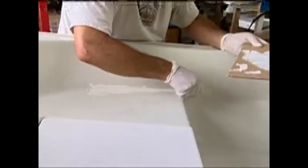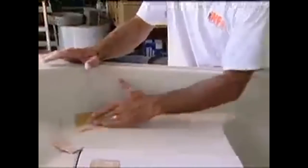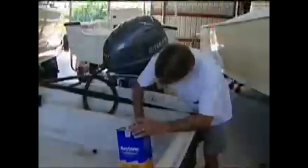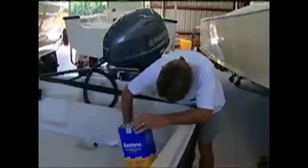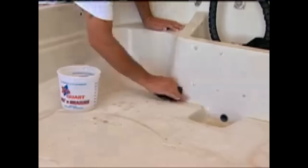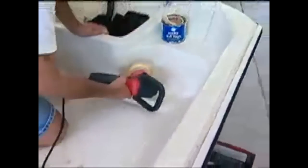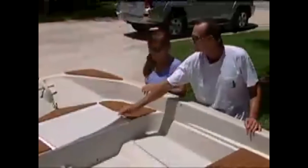After that cures, we'll hand sand it using 100-grit dry paper, wipe it again with acetone, and then do a little bit of wet sanding in the areas around the boat. We should probably also do a little compounding in here — you've got some oxidation that we need to address to bring the boat back a little bit. Right now, you guys are going to see a couple of different versions of the SeaDeck and how the boat's going to look once it's complete.